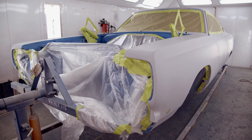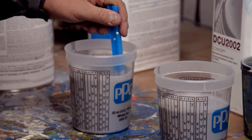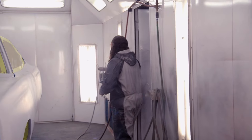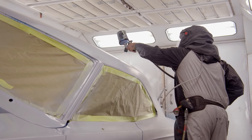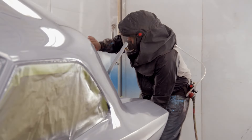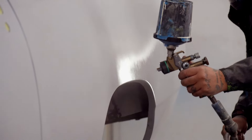Now that we're not doing pre-paints, we seal the cars. The car finishes in 400-grit; I use PPG NCS 2004, a gray sealer that fills like 320-grit scratches. Two coats of sealer fill any light scratch or faint imperfection so when it comes time for color you're painting over a perfect finish. When doing any metallic, the concern is prep work. If there's a 220 or even 320 scratch that isn't finished correctly, you'll base it, clear it, put it outside, and see a sand scratch where the metallic lays right in that groove — it can run the entire side of the car if not prepped right.